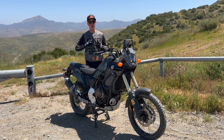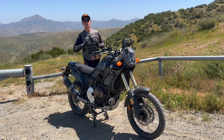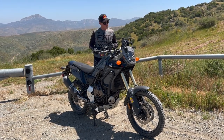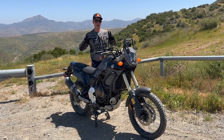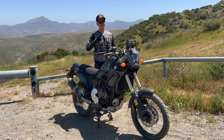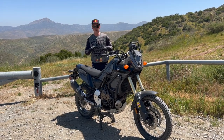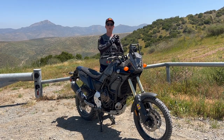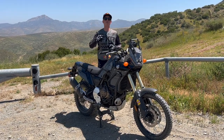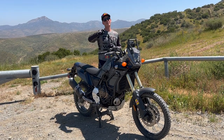Once the rear is locked and you're skating, that's where the front brake comes in. You're fully locked on the rear starting to slow down, and while the bike is skidding straight, gently squeeze the front brake lever to improve your braking power. That way of stopping is very effective. Be careful — once you start engaging the front brake, weight transfers to the front, and in full lock mode it's really easy to over-grab the front brake.